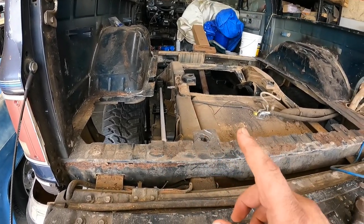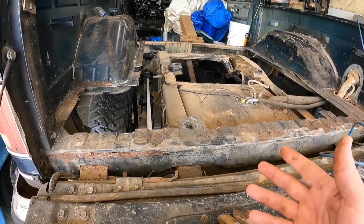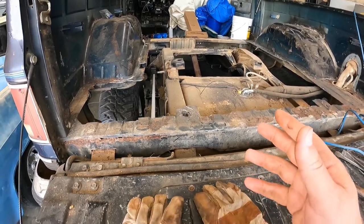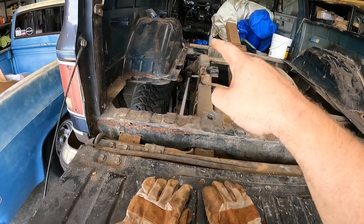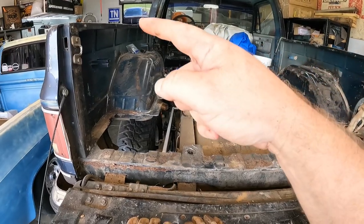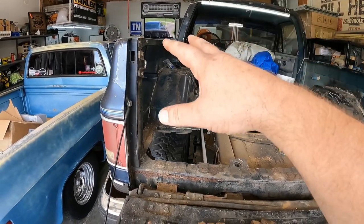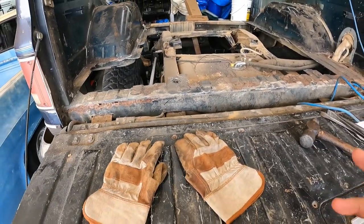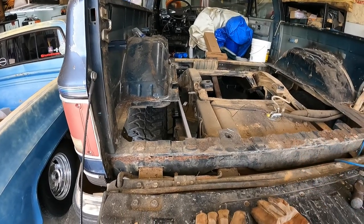So one guy that I saw that actually had some K5 content, primarily focused on the tail panel, which I didn't need, I saw it and I was like, oh, let's check this out. But I don't remember the YouTube guy to save my life. I can't remember his channel, but what he ended up doing was he took some 2x4s and built a little bracket or a little brace that comes up off the frame rails. And then he took another 2x4 and went from bedside to bedside, just up underneath the bedside lips, and had it all bolted together, strapped down good and tight. That way it held the bed at the height that it needed to be. It kept the sides square, and then he cut his tail panel out. So that's one big thing: don't cut this guy out unless you've got all this other stuff braced up, because if you do, you're going to have a bad time.